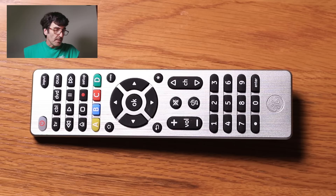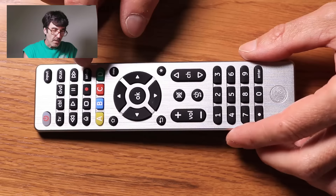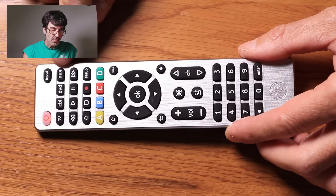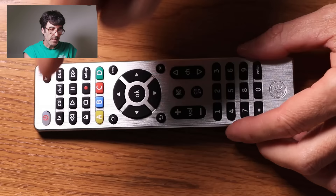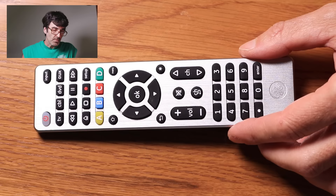There's one more pretty neat feature on this remote I should show you — the master volume feature. What you'd use this for is, say you have a soundbar and you want to control the volume of the soundbar without affecting the TV or the satellite box. Here we go with setup — push and hold. I've got the Bose set up on the auxiliary input, so push auxiliary, then mute, then volume up. Now I have the remote in TV mode and it should still control the volume on the Bose. As you can see, the light is flashing on the Bose, so that's working great.